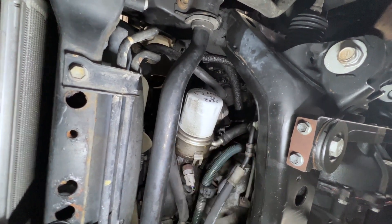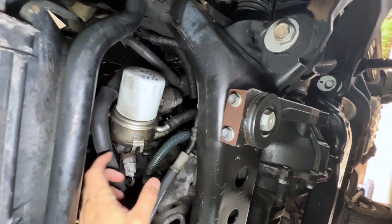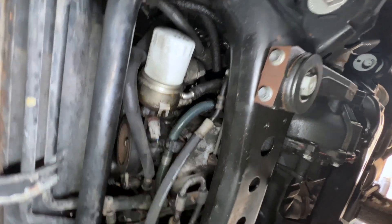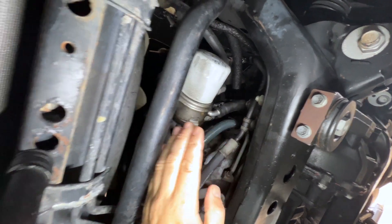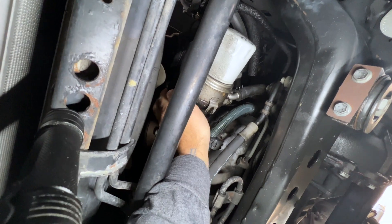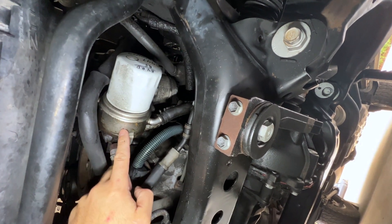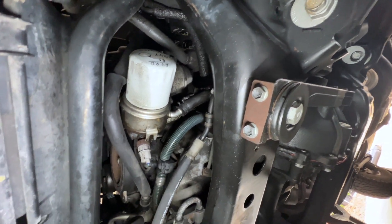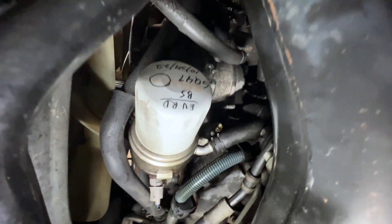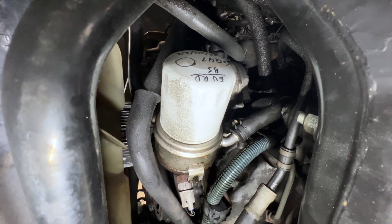Underneath, this looks way cleaner. If you peek all the way in the back it's still really gunky, but the majority of the leak is coming from right here. We're going to move this line out of the way — right above it there's a coolant line we're going to clamp, and then we have to clamp this one right here too. This one up top is small and tight, so it's going to be a little difficult to clamp. If we do lose some coolant, I have extra. We're going to separate these pieces and remove the adapter from the block.